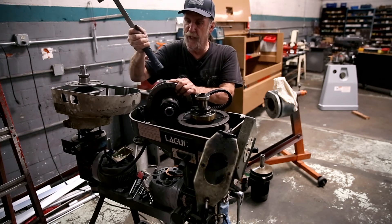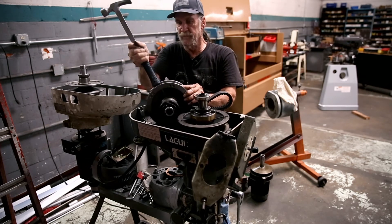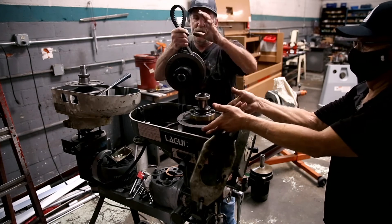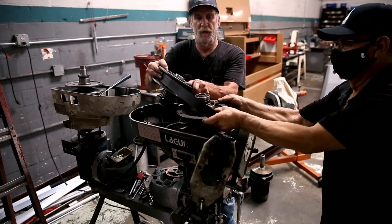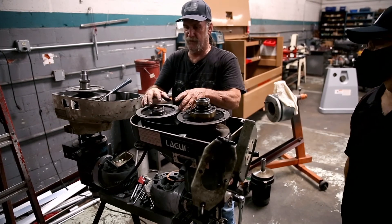What we're doing here is collapsing the spring and expanding the pulley, and it takes a little bit of doing. Once the pulley is up, have an associate hold that pulley up for you — you always want to make sure it doesn't slip back out. Slide the belt underneath the front pulley and then set it right back down inside the same place where you got it.